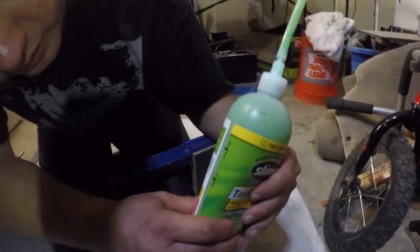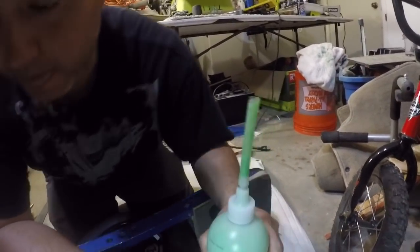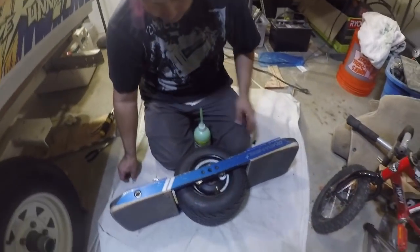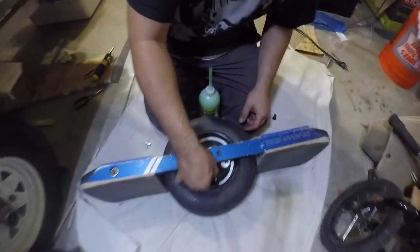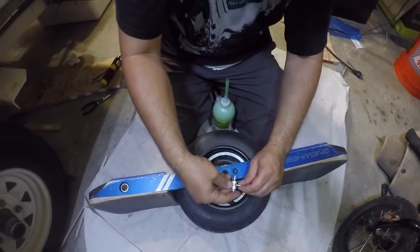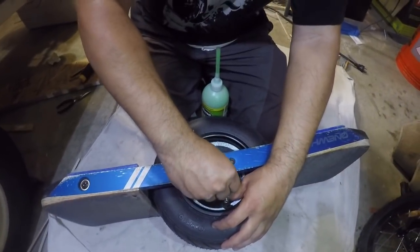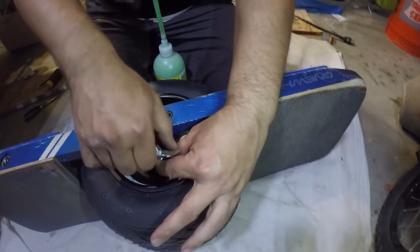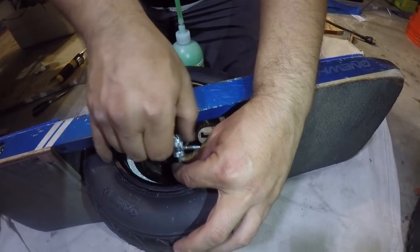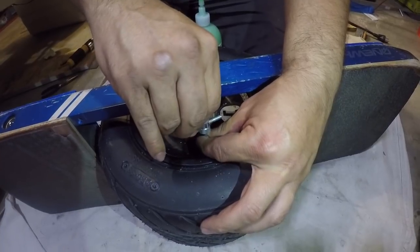The reason you want slime — it's not just for when you have a flat. When you're riding and you happen to get a little poke or something that creates a little leak, it'll help plug it up real quick and get you home. You don't have to carry this 26-pound thing around. We put four ounces in — go ahead and tighten the valve back. Just tighten it until it gives a little resistance.